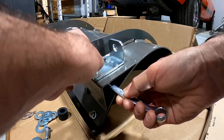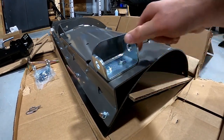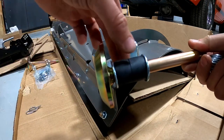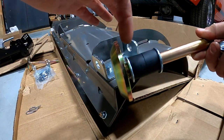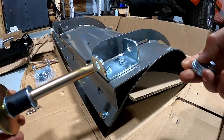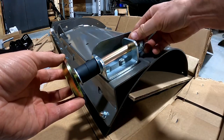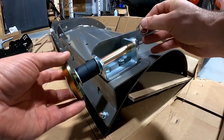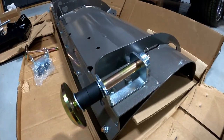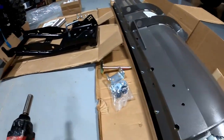We'll get these tightened down. Now that we've got our mount bolted down tight, we can put the plow shoe in. Per the directions, for starters you use one washer, both of the thicker rubber grommets, then another washer — slide it in. Then stack all the remaining washers on top to keep it from getting floppy, and slide your pin in. That's the plow shoe. I'll go ahead and do the same thing on the other side, then we'll stand the blade up and get it attached to the mount.